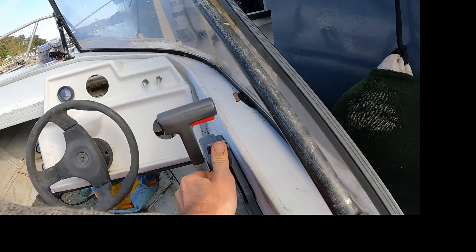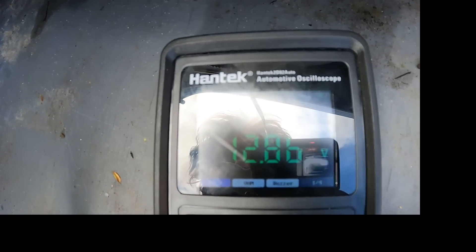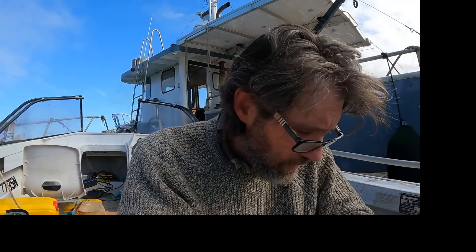As you can see, it starts and runs really nicely. The surface charge on the battery would have gone when we cranked it — so if you've just charged a battery and you're doing a battery test in a car, for example, they say turn the headlights on just to knock that surface charge off. That inflated voltage reading isn't really a true body reading. When I turned the outboard off, the voltage actually went up again. So it looks as though the engine when running — for spark and EFI high-pressure pump and all that kind of stuff — is drawing power from the battery, not from the regulator rectifier.